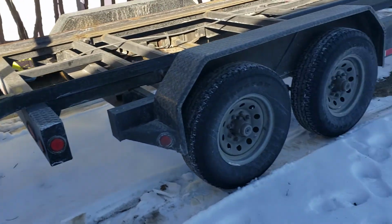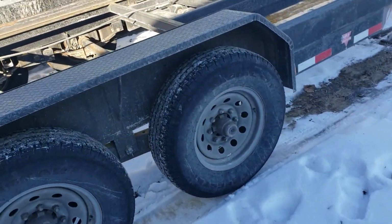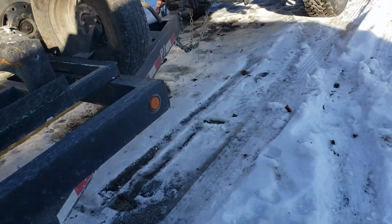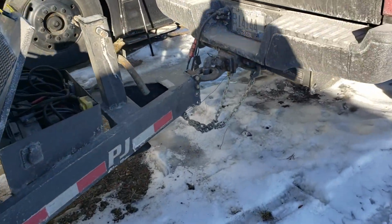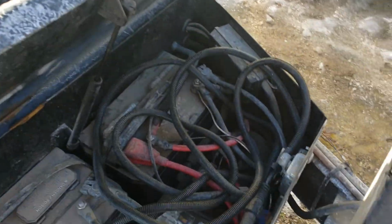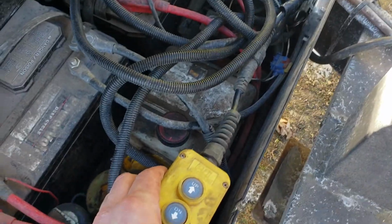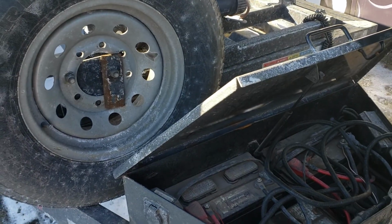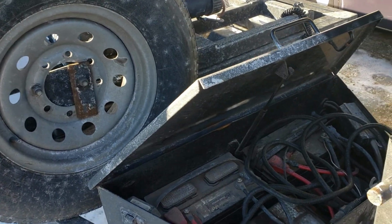They're starting to get really expensive right now. Tires, I would upgrade. These are just a 10 ply. You need to upgrade to a 14 or 16, even 18 if you can find them. I have a lot of good things to say. Like I said, it's just a little bit light duty for what we need. And we're going to go standard rail and go big time is kind of where we're headed.